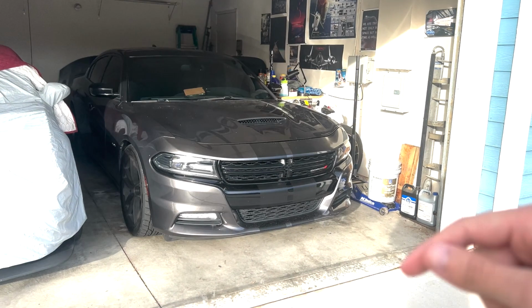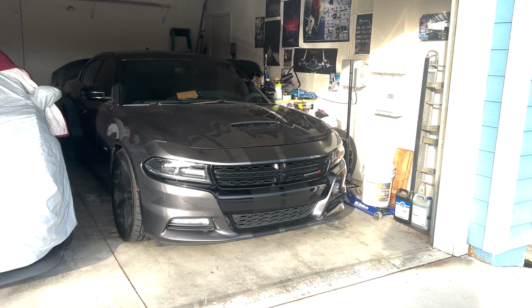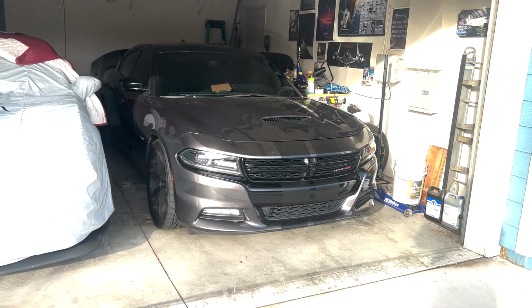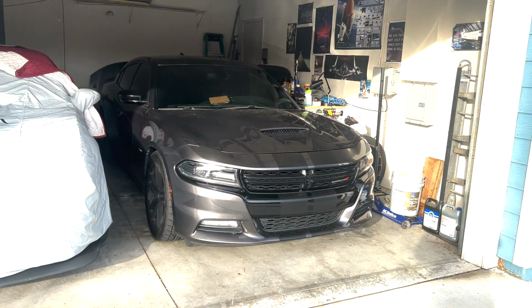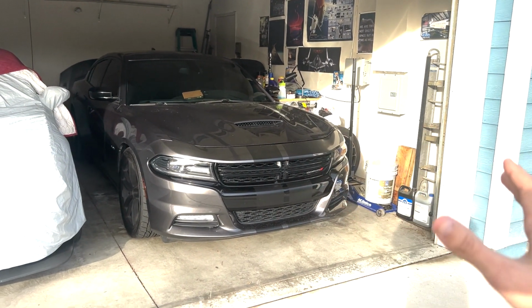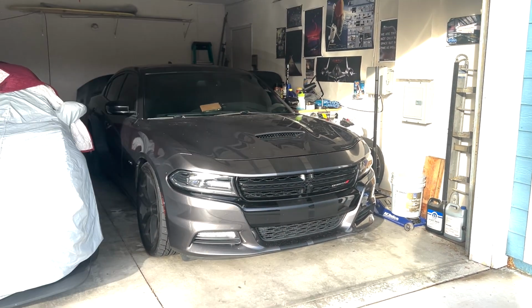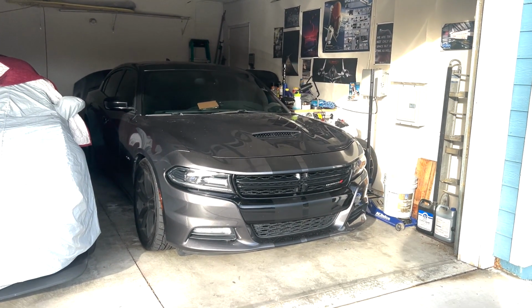The day after you guys see this video, I'm taking it out to Irwindale, and I'm gonna try to get those logs for him so that we can really get the converter dialed in and actually tuned for it. But right now, the transmission has my regular cam trans tune on it. No adjustments for the converter just yet. In this video, I'm gonna let you guys know how it drives around town.